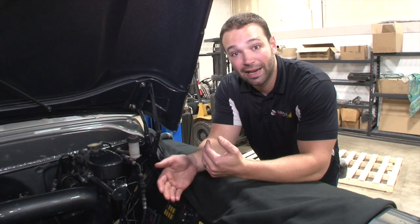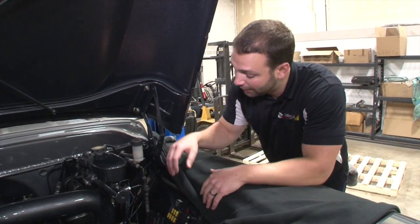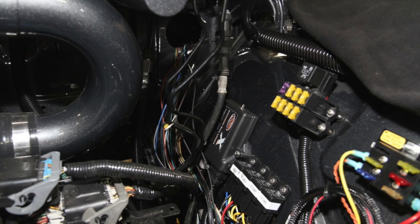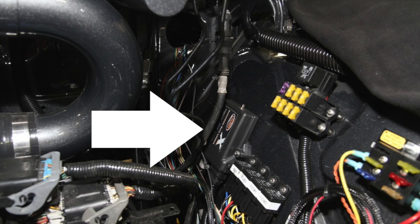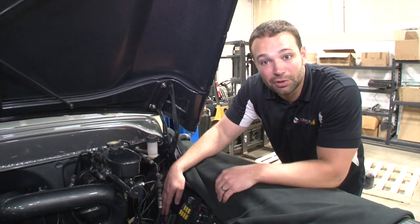Those are the things we're going to be really focused on improving as the season goes on. So we've elected to use Fleece's XDL data logger system — a system that piggybacks into EFI Live and allows us to add external inputs so we can keep track of the turbocharging system. The XDL box mounts here on the fender well and plugs right into our EFI Live V2, and then we can plug a USB cord into our computer to pick up that external data.